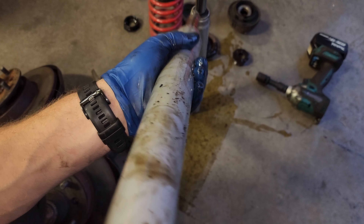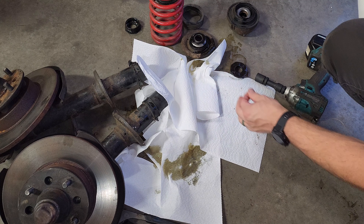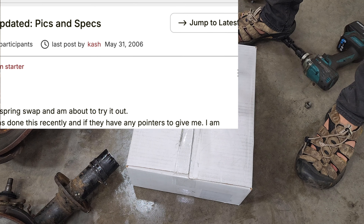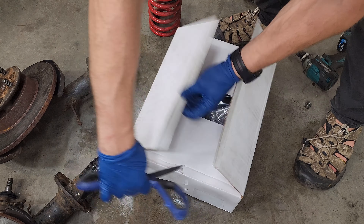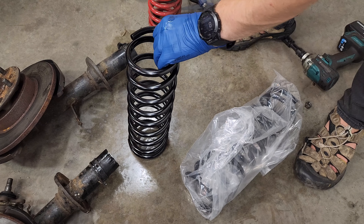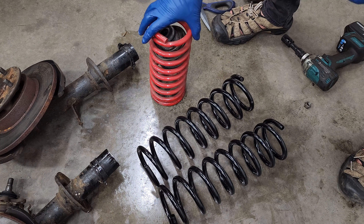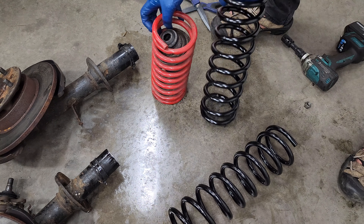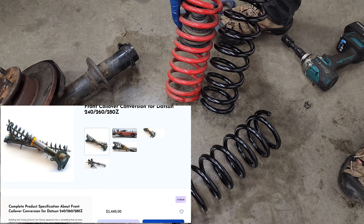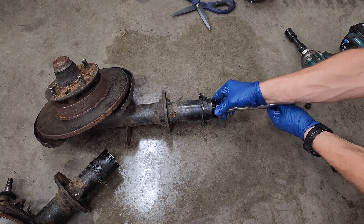Here's the plan for the suspension. According to some nearly two-decade-old forum posts, front springs from a 1980 Chevy Chevette will bolt right on. I'm doing this because it's impossible to find stock-height replacement springs since Nissan no longer sells them and everyone's answer is only lowering springs or coilovers. But this is a budget build, and spending under $100 for all four springs versus thousands for coilovers is a wicked good deal if this works out.